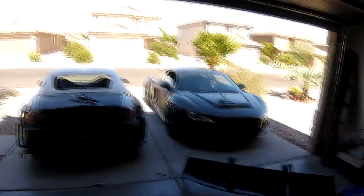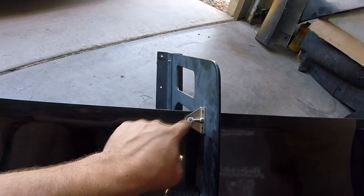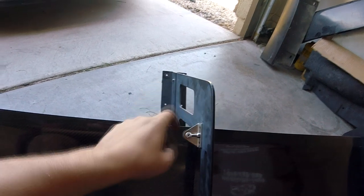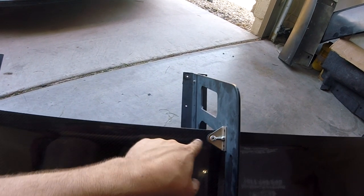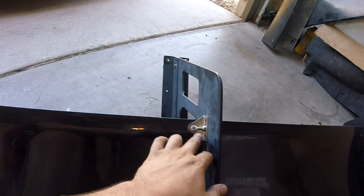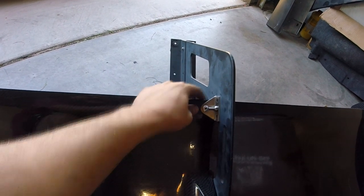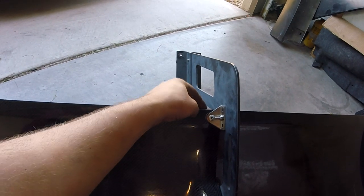So just a small update — my GoPro battery died, but all I really did was fix the wing. Besides the bad condition of this, there's a front bracket to this wing held in with a rivet and this one was basically broken — the rivet ripped a hole bigger in the carbon. Luckily I have a ton of rivets and rivet guns because that's all I used to build the M3. I bored out the hole on the bracket and used the bigger rivets, so now that bracket is attached because before it was actually flopping.